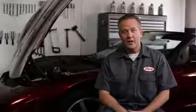The first thing you'll want to do is drain the old oil from your engine. But before you do so, there are a few things to check. First, make sure your engine is cooled down so you don't burn yourself. Pick up a set of ramps from your local auto parts store. They're usually $50 or less, plus they're easier and safer to use than a jack and jack stands. Also, chock the rear tires.